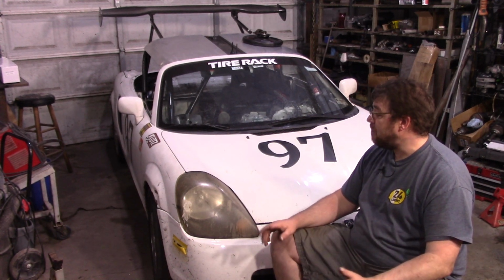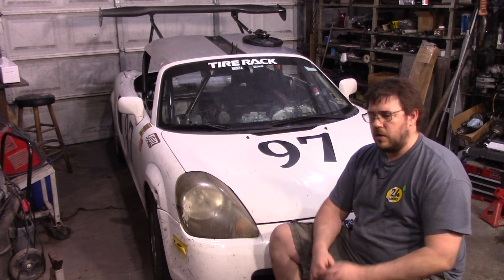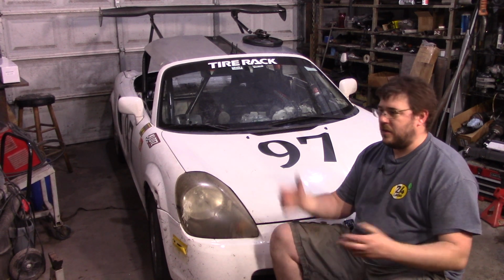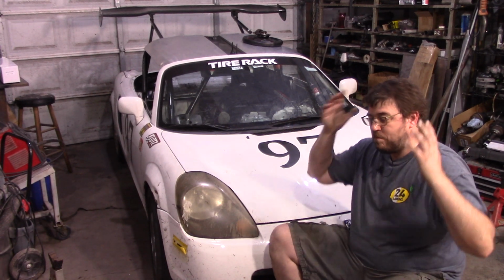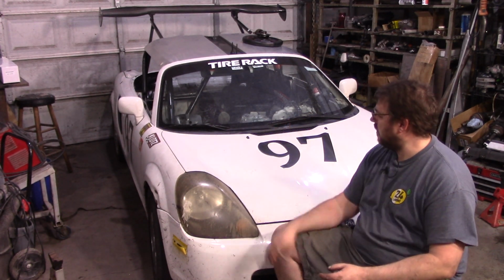And yeah, you know, here's the thing. Even if these axles don't last longer than the previous ones did, these are a lot more serviceable with that joint that unbolts and whatnot, and the fact that I can buy them. That's a huge thing right there. You know, these reman axles, they're kind of a pain in the rear. You got to buy 3 different ones, and one thing that I've been noticing as I've been buying more is you order remans and they'll send you new ones instead, which that'd be great most of the time, except I'm counting on those inner splines. So it's been a bit of a pain, but this will hopefully fix that.